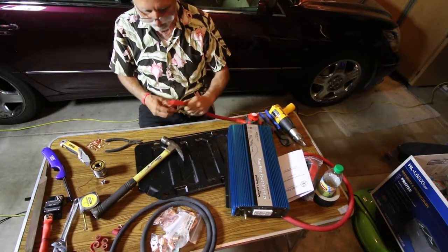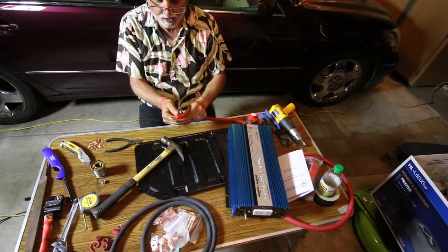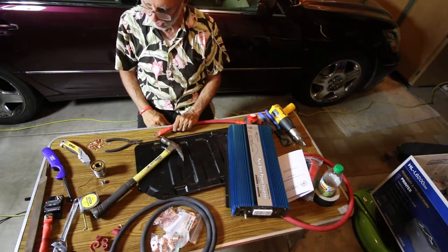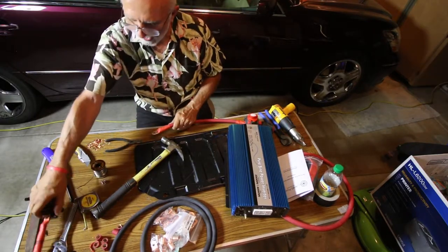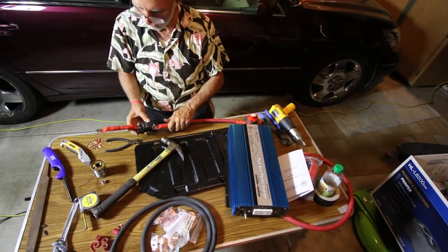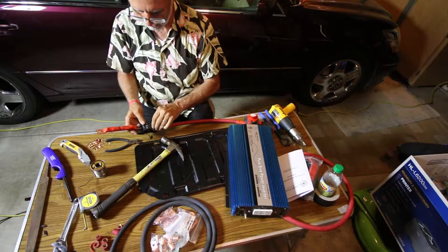I'm not going to have a cold solder joint here. I've got pieces of heat shrink insulation pre-cut at about two or three inches. I do see a little bit of extra solder that splashed, so I'm going to file that down because it's got sharp tips and you don't want that going through the insulation. Use a bastard file — that's one with a really big cross grit on it. When working with electronics, don't let solder specs get into your inverter. Keep metal debris away from the inverter. The connection is solid — on goes the sleeve, heat gun shrinks it down, and we're ready to hook it up to the circuit breaker.